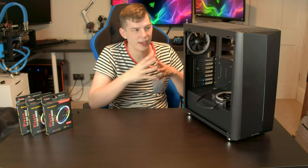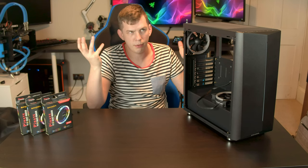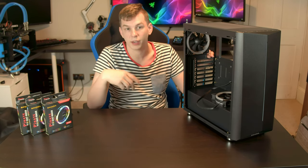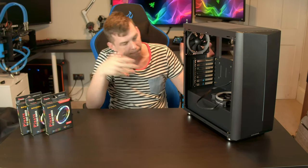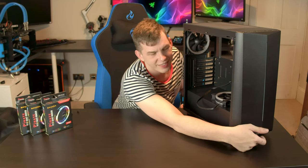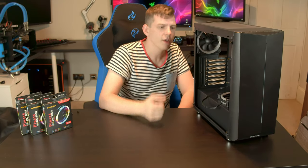When it comes to 120mm AIOs, I don't really think there's much of a place for them because for the same money you can get as good or even better performance from a decent air cooler. Air cooler support goes right up to 170mm, which means the infamous Cooler Master Hyper 212 Evo will fit this case - it's the benchmark for cheap decent aftermarket air coolers. Smaller options like the be quiet! Slim will also fit without a problem. There's also intake across the bottom - a good couple of inches deep - so a decent AIO shouldn't have any breathing problems.